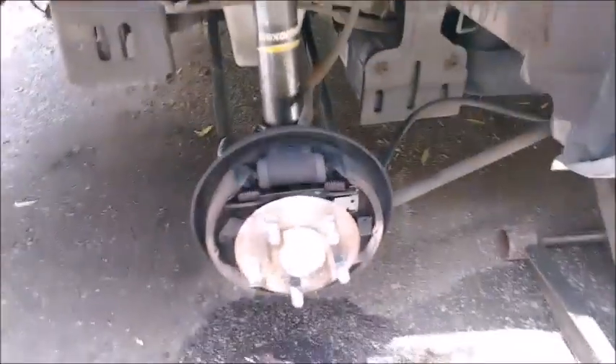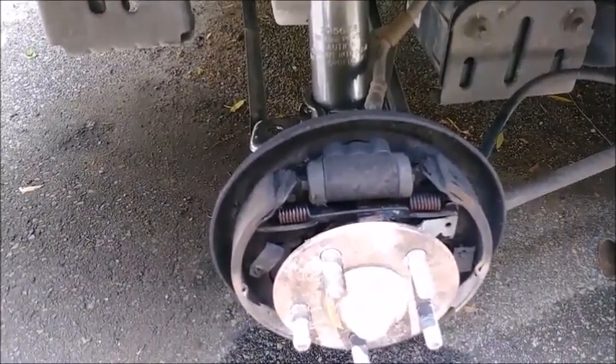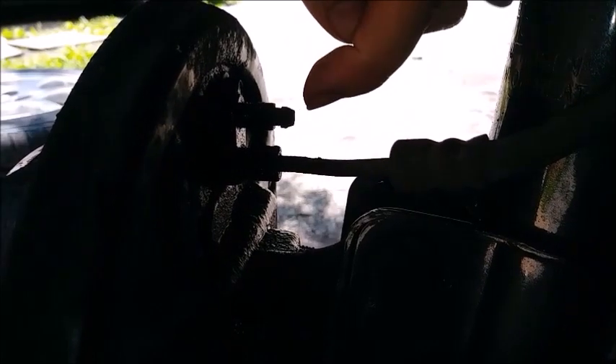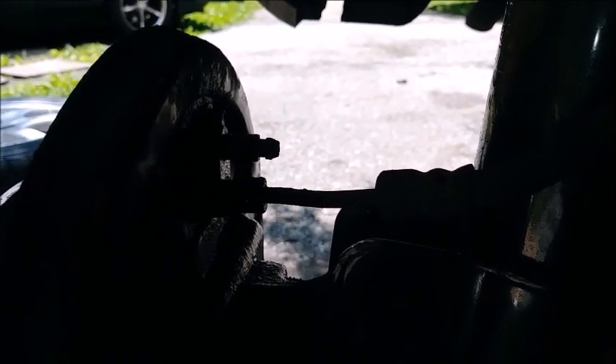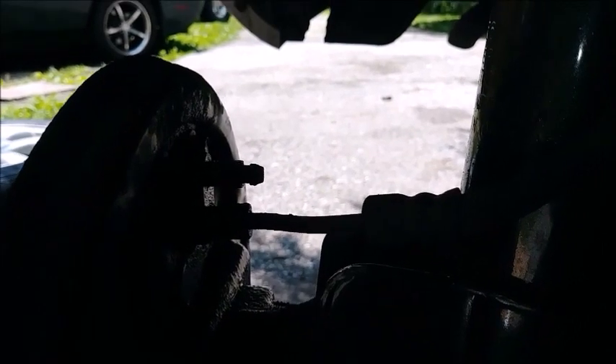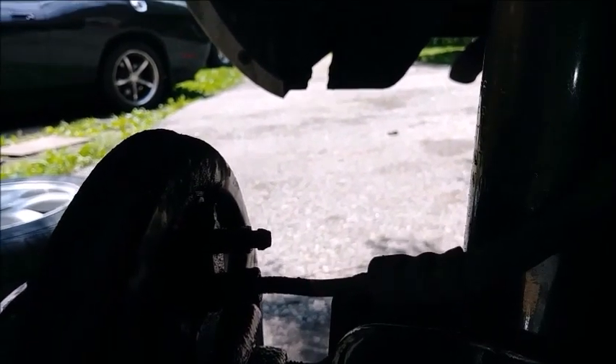Before I start taking everything apart, since we have to do the wheel cylinder, I'm going around to where the brake line bolts in. Before we use the flare wrench we're gonna spray liquid wrench and let it penetrate so we don't strip anything trying to take the brake line off the wheel cylinder. Went ahead and liquid wrenched the bleeder valve and the brake line. Let that soak, and by the time we're ready to crack it open we'll blast it again for good measure. First things first though, we'll disassemble and then put it back together.